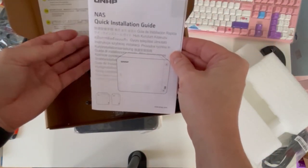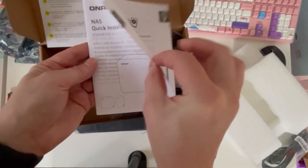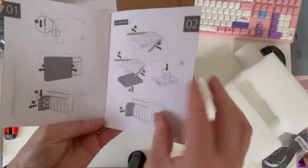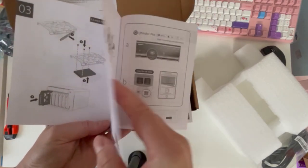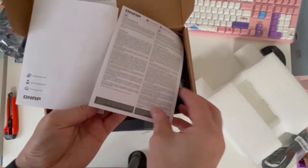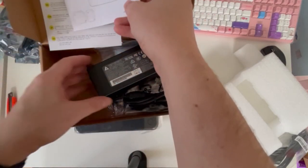While we are looking into the quick installation guide, I'll continue with specification and don't worry, I'll list it in the description under the video. There are 3 USB 2.0 ports and 2 USB 3.2 Gen 1 ports. It has HDMI 2.0 output with resolution up to 4096 pixels of horizontal resolution up to 2160 pixels of vertical resolution at 60Hz, allowing you to directly view multimedia content saved on the NAS on a bigger screen in real-time streaming.